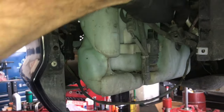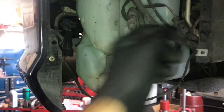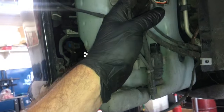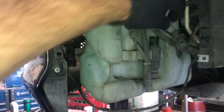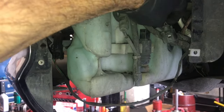So what I do is locate where the bottle is and unplug the actual pump. Most pumps have a two-wire connector, so I'm going to test at the pump to make sure it has power and ground. If it does, then we know the pump is malfunctioning. If it doesn't have power and ground, then we know something else in the circuit — like a relay, a fuse, or the switch — is bad.